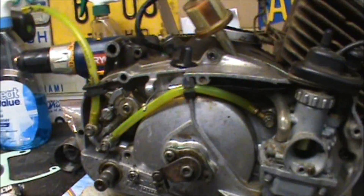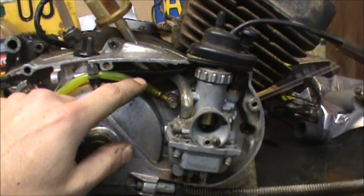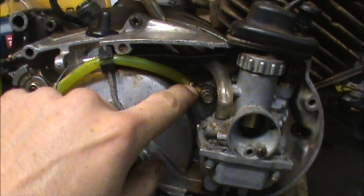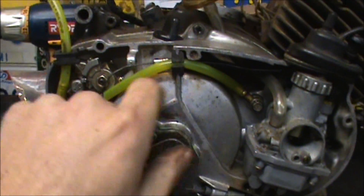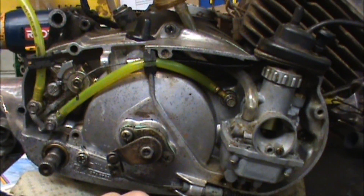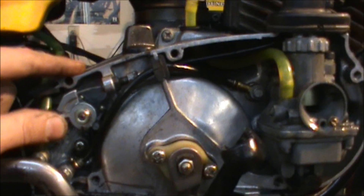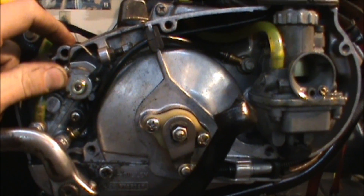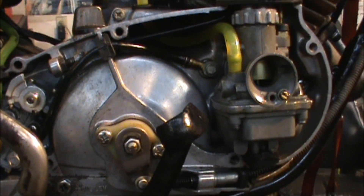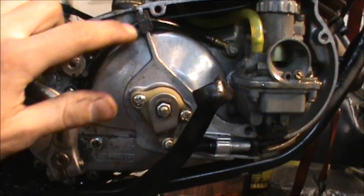On my last video, I started up the old Kawasaki and from where it had been apart, I had a little bit of air getting into the line right here. There's more than one way to skin a cat — you can pull this off, use a little squirter or something, and try to fill this up with oil, then connect it. What I did was mix a little bit of oil into my fuel, put it in the tank, and watched it. As I had it running — since these are separate cables, one for the carburetor and one for the oil — I just held this forward like wide open throttle, so it'd pump a lot more oil than at idle. That way it sucked through here a lot quicker, got the air out of the line sooner, and I was mixing the oil a lot more precisely. That's a little idea for you after you take this apart and clean it.